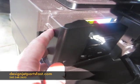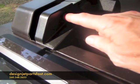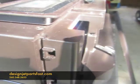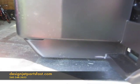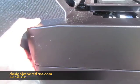Right there are the hinges. With those two covers off, we can take the left cover off, which requires opening the window. There's one screw here, a screw down here, and two screws on the inside. On the outside, with the hinge cover door off, you can access that screw hole there. There's also a screw down there. Make sure you unplug the power connector right there before removing the cover.